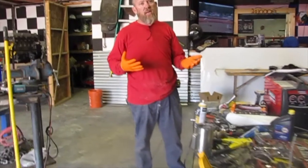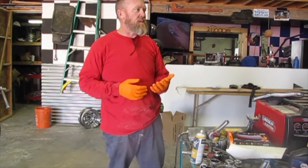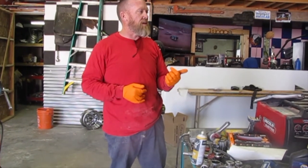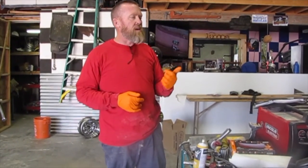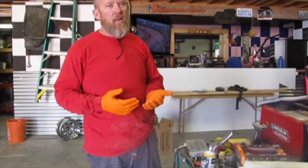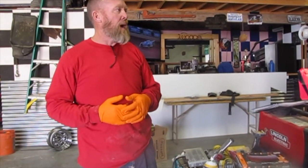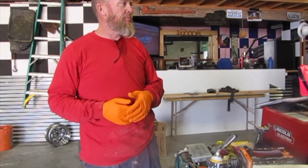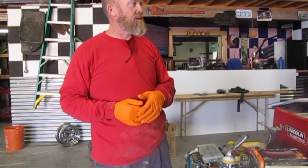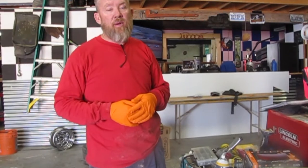For a test drive, the brakes still need to be adjusted. It's still going to the floor, so we'll do that. The steering, where the steering mounts on the right front, needs to be raised because I had it set for a rack and pinion off a Chevette instead of the DNR steering. Need to do that, and just the cosmetics of the bumpers and the nerfs. After that, we'll try it again and see what else we've got.